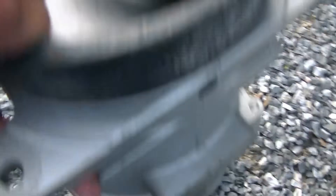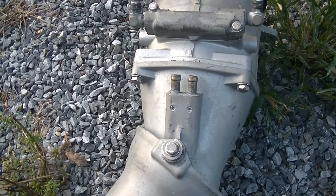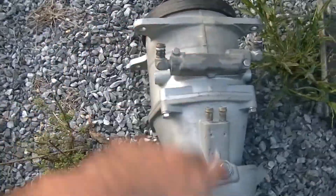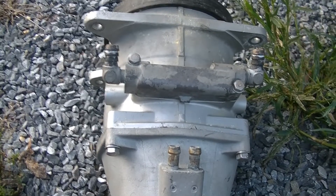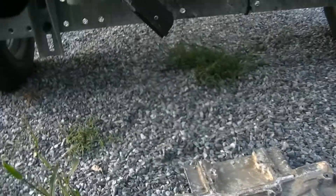Here you'll see the steering nozzle, which also unbolts, but I haven't gotten to that point yet. At this point we're going to go ahead and add a jet pump housing assembly to our list. We're also going to need a new impeller, as this impeller here is not exactly in the best of shape. It's not the worst, but it makes more sense to just get a completely new housing and start fresh. What we're probably going to do is buy a brand new jet pump, put it in our newer jet ski, then take the jet pump from that, rebuild it, and put it in here.